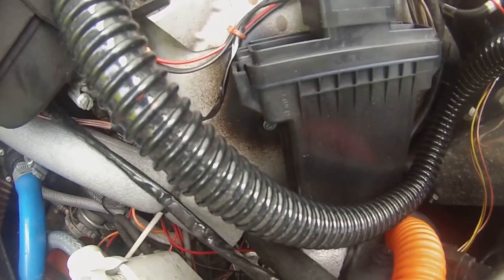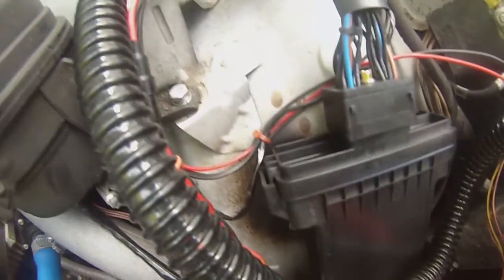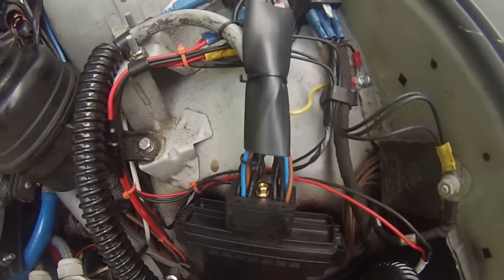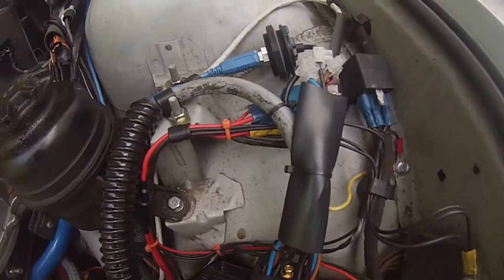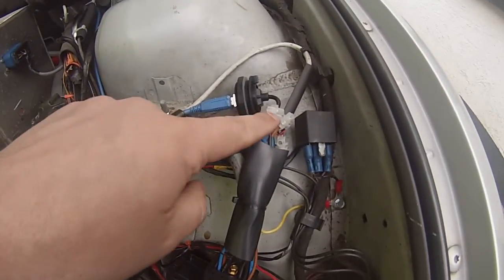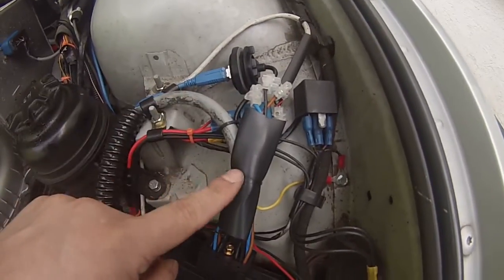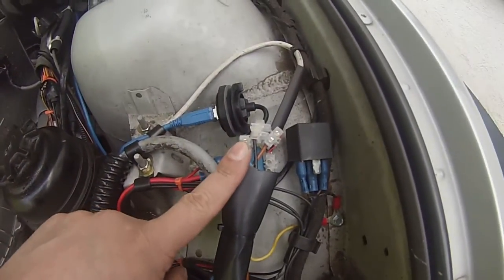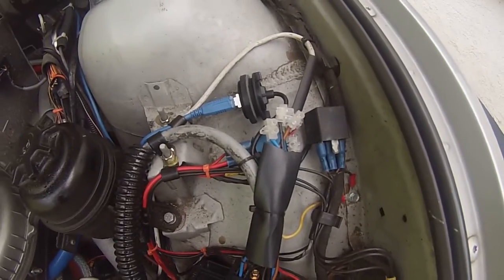So basically that is just attached in there by means of some self-tapping screws. And we have our cable harness made up and coming around, and up here, these are our one wire temperature sensor connections. I have not heat shrunk them. As you can see, I have a piece of heat shrink here waiting to go over these guys, because we're still experiencing difficulties with those one wire temperature sensors.